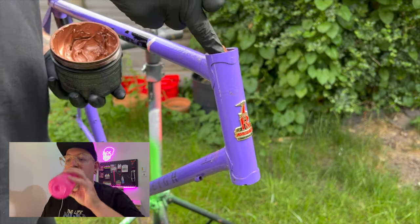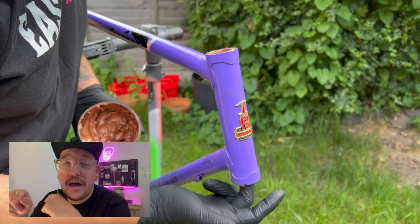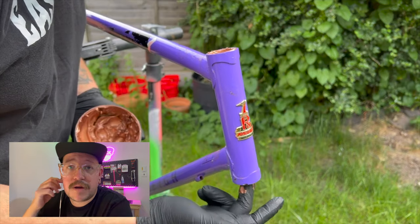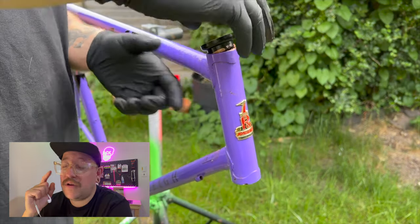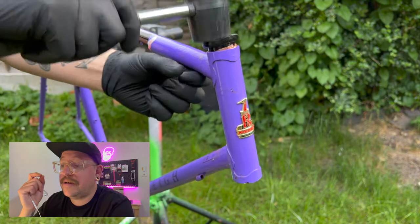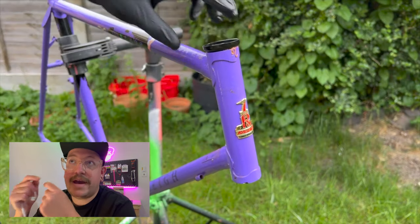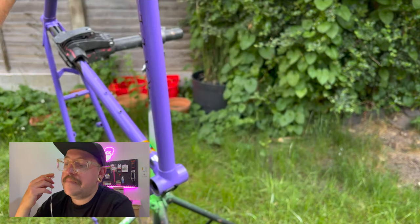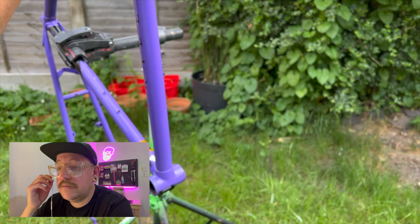This bike is a large frame — I'm right on the cusp of medium. For a while I was using copper compound on the headsets and bearings, and you lot went mad about it. I had no idea it has fragments in it essentially, and it will wear away the bearings quite quickly. I don't think I ever cleaned it out, but I probably shouldn't have done it.